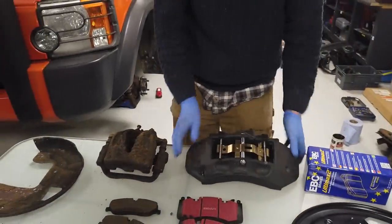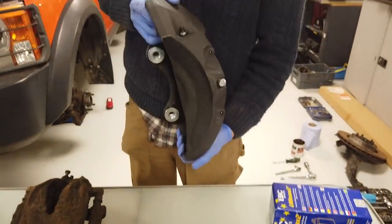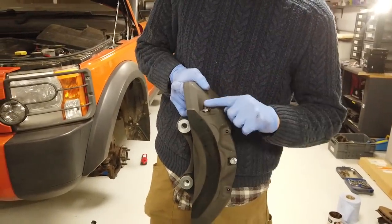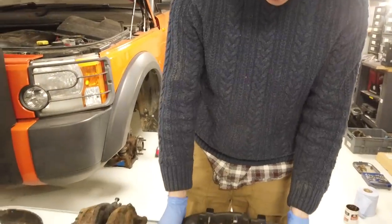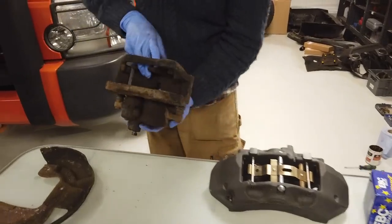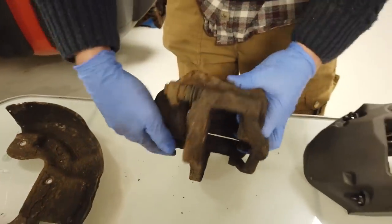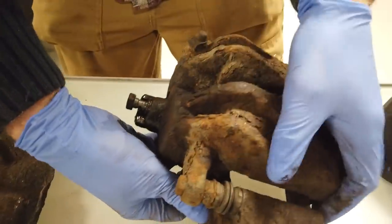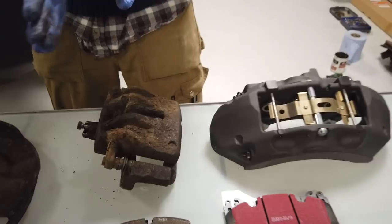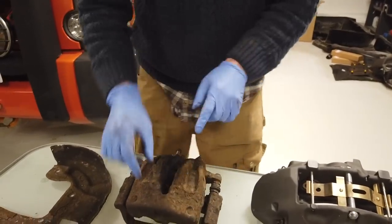So, the caliper - this is an alloy body caliper. You can see the brake pistons in there. They're handed. When you mount them on the car, the bleed nipple has always got to be at the top - that's how you can tell which side it is when you go to bolt it on. That all comes complete, ready to put the pads in. The old style caliper has only got two pistons and that pushes against the disc, and the thing that always messes up is these bellows - it's all supposed to slide in and out, but they seize up and then it doesn't work and you get uneven forces where it just pushes on the rear pad, not the front one. So you're better off getting rid of that - it's just not that reliable, but cheap to make.